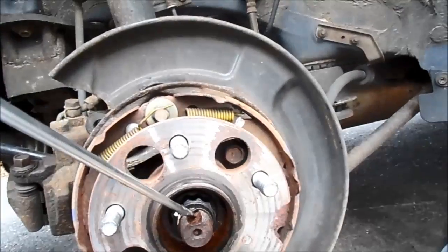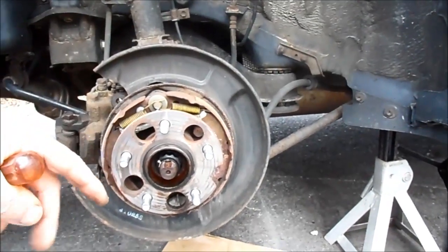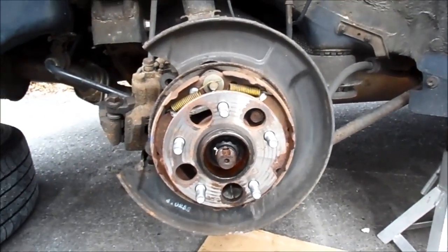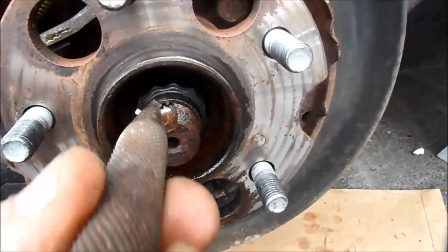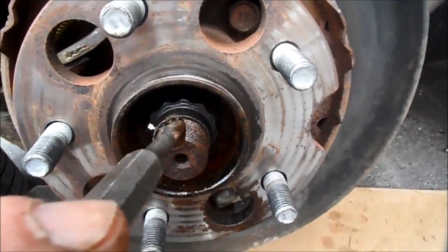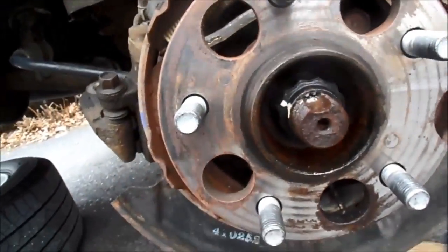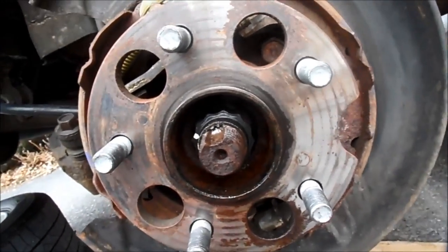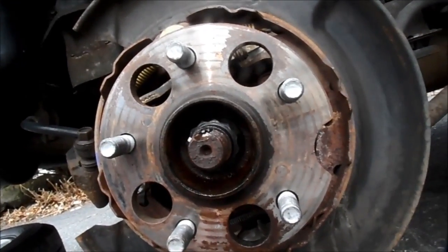So I'm gonna start working a punch into there, and then we'll put the tire back on, lower it down — and don't forget your jack stand — we'll lower it back down and then break that free. I started with this punch and tried to work it up on both sides, and then worked this punch into it. See if we can get that up there, hitting it with the hammer. Now what I'm seeing here are the threads right there. It's kind of dicey — you gotta get that up though. I think that's what we need.